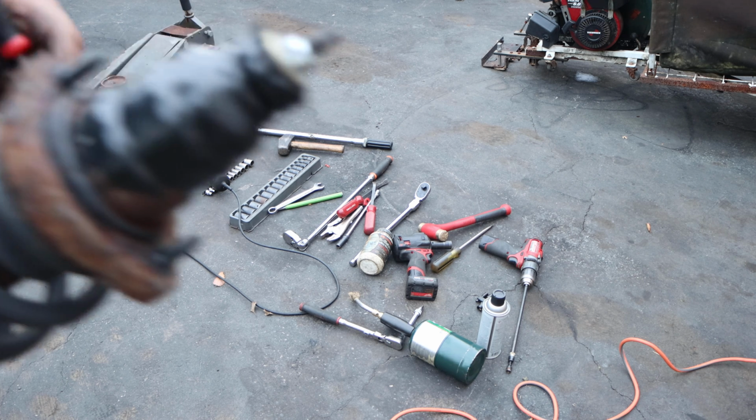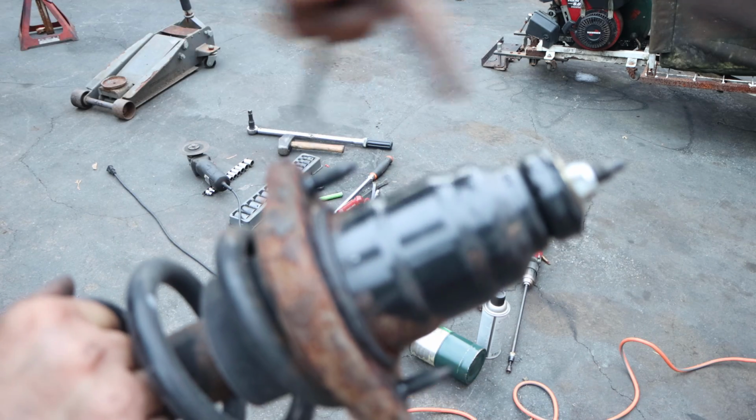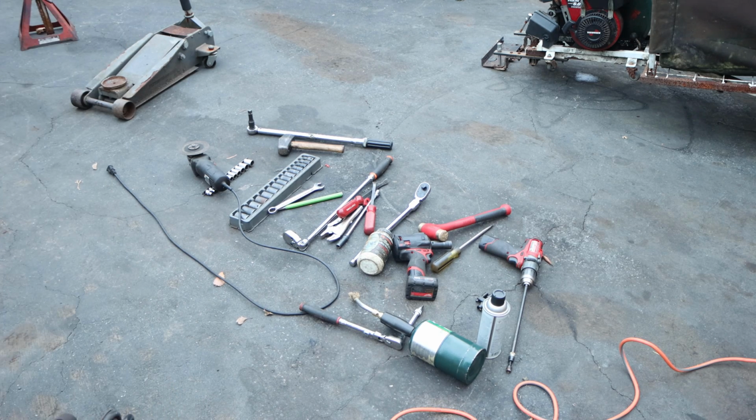The driver's side on the hat actually starts to bottom out and push my short socket up, and I don't want to strip it. So deep socket, short on that. Get a 3/8 general socket set, because the nuts that were on the Honda were different than the one here, and I didn't want to reuse the hardware.